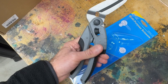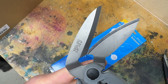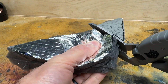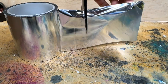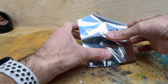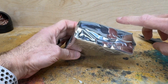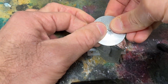Let me share a few things I learned after working with this foam. These scissors I got off Amazon are perfect — the handle is comfortable and the blades are at a perfect angle and serrated on the edges to help cut through the mass-loaded vinyl. Depending how sharp your knife is, you'll have to make a few passes to get through the reinforced foil surface of the foam and then the foam itself before cutting through the thick vinyl center. I'm just going to demonstrate here how thin the mylar tape is when you cut it — be very careful, it'll love to stick to itself. As you can see, it seals real nice and this back part is going to be against the boat. I'll quickly show you up close how you attach the foam to the hangers.